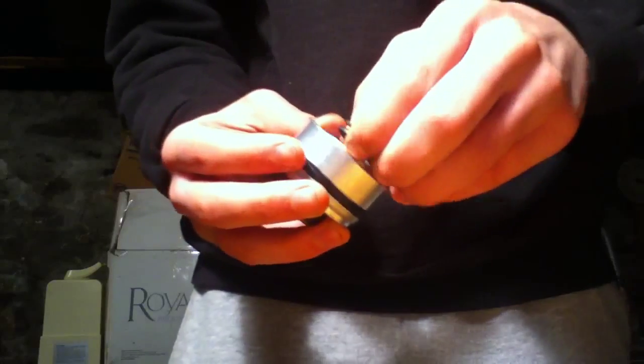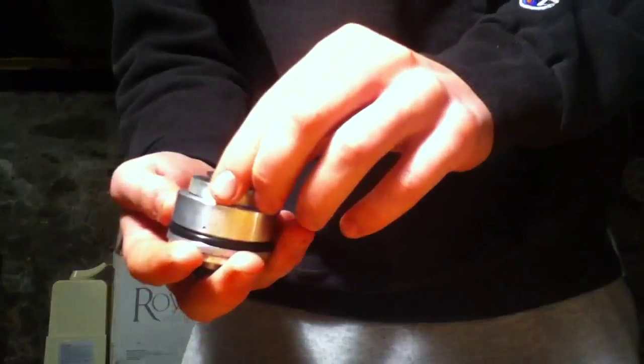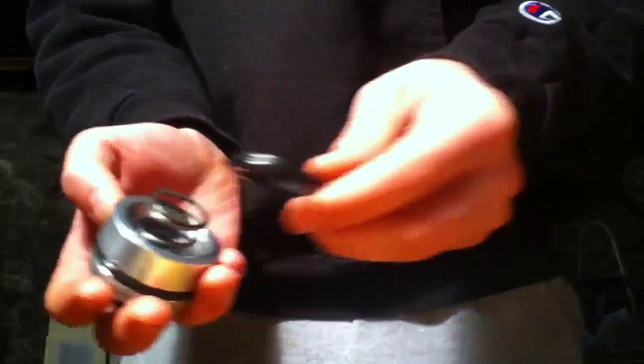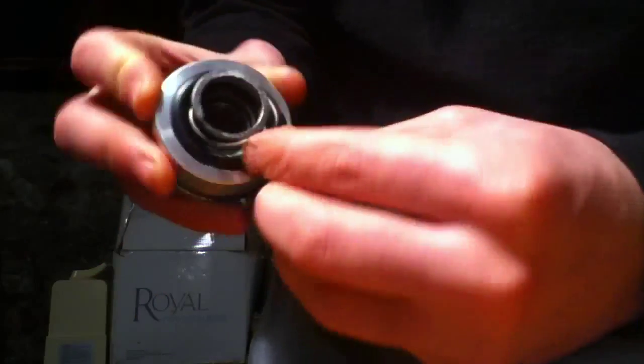This spring goes in like so, and this little aluminum collar goes over there — gotta go in nice and even. Lift that out and try that again, it went in crooked. Just gently get that all in. Get that washer to seat in there — there we go. Put this back in — that dropped in. Then we have our top-out bumper; this just kind of squeezes into the recess of the head here.